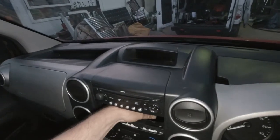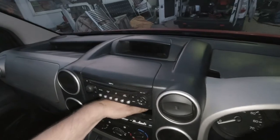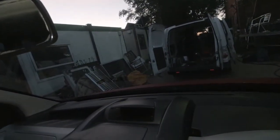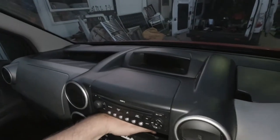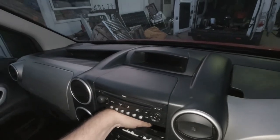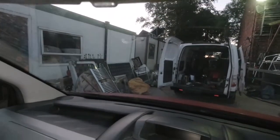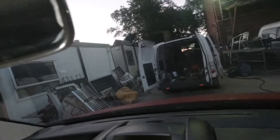And reach back through. Remember, you're going the opposite way now — clockwise looking from the back, anti-clockwise as you look from the front. What I quite like to do when doing this is turn the lights on, because it's a good indication that you've got the bulb in the right place, because you'll see it light up as you put it in.